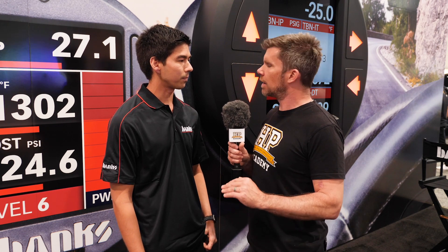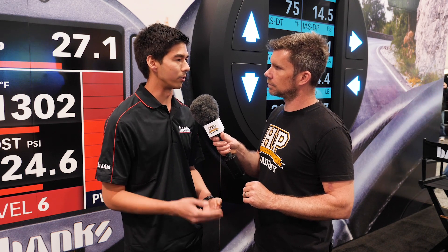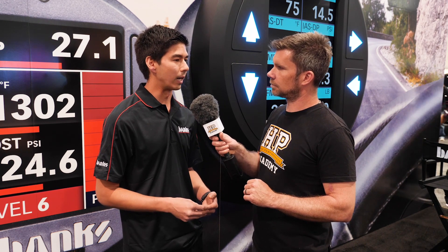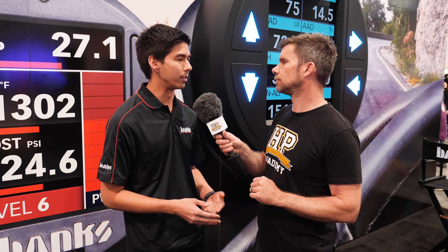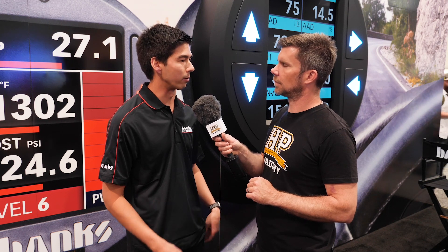That's not great when talking about emissions-equipped vehicles. So the other aspect is the manifold pressure signal — you're intercepting and cheating that signal as well. By adding extra fuel you're going to get rich conditions, extra soot, higher EGTs, and be limited in the amount of power you can make. By intercepting the manifold pressure and tricking it to add extra air or boost pressure, you bring the air-fuel ratio back to its original level. That gives you better control of EGTs, less chance of excess soot, and basically a safer, more sustainable power level.